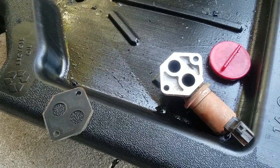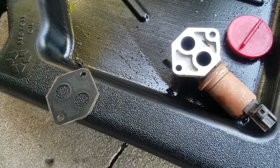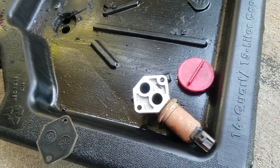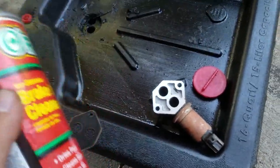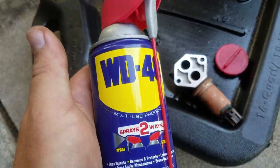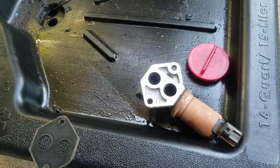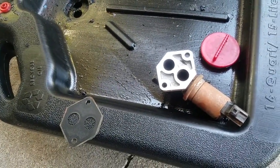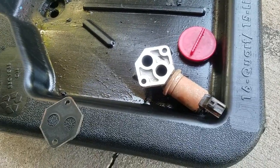I pulled the gasket off — do not yank or tear this gasket, it lifted off easily. What I'm going to use is brake parts cleaner because that's what I have, but you probably should use carb cleaner. I was also reading about spraying some WD-40 inside it, and it helped smooth out someone else's idle. I'm going to try that. This truck has always had a rougher idle, kind of searching — maybe this sensor is bad and needs replacing.